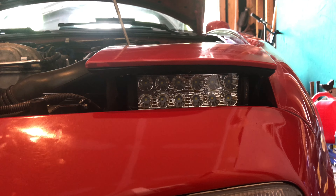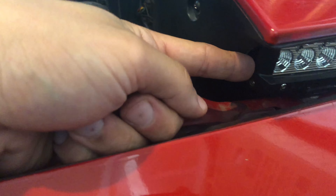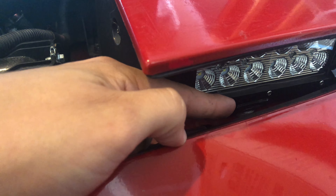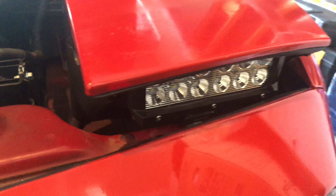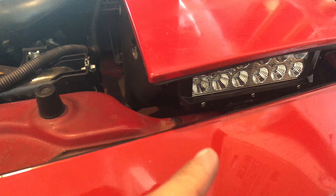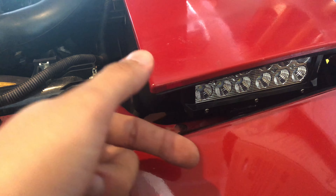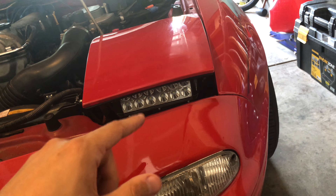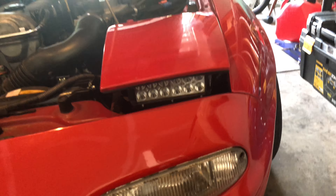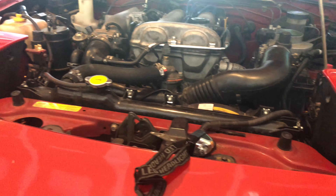If you want to use more washers that's up to you, but you might need a longer bolt. The bolt for the bracket is different from the bolt that bolts onto the light — there's a bracket bolt and a separate light bolt. When you see the kit you'll see in the pictures it has the two different bolts. I like this bracket because I can angle it forward, down, and back. Right now I have my lights angling down since my car runs really low — my lights don't blind anybody, but you can still see them from a distance.